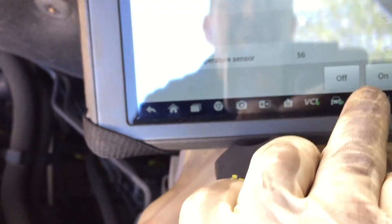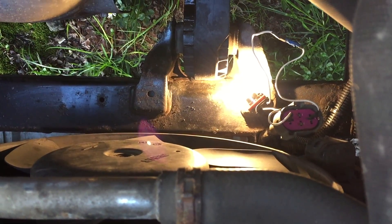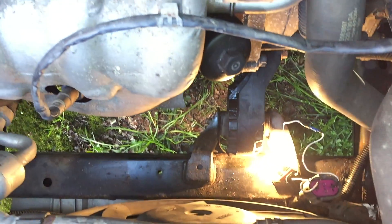We'll activate it on and you'll see your test light comes on — there you go. That proves the fuses and everything else. Those are the terminals that carry ground and the 12 volts. I also want to check the middle pins to see if they're okay.